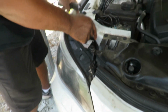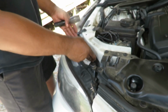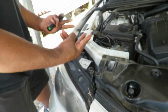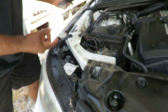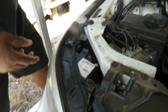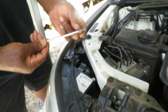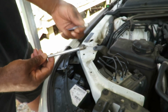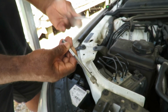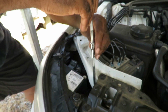Now the two down there, the T20 bolts, do not take those out. Just loosen them up because the headlight got two slots down there like forks and they just slide onto the bolts. So what we're gonna do here is we got here a T20 socket, 1/4-inch drive with a 6-inch 1/4-inch drive extension, and we're going to add to it a 5-inch 1/4-inch drive extension. And we're going to reach down there